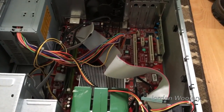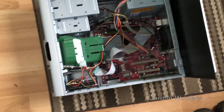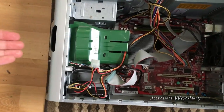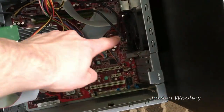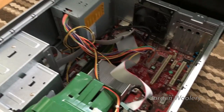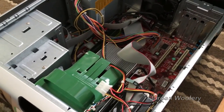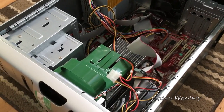The E2600S is effectively a thin but tall business-class desktop which used the exact same motherboard. This is a BTX motherboard, and you can get a good look at the BTX style form factor. What BTX was trying to do at the time was to make a more efficient cooling design — the CPU sits on one end of the motherboard, cold air comes in through the front of the case, is blown past the CPU by a big fan, and is exhausted out the back. Dell used it with their 700 series Optiplex and the GX620. It didn't get too terribly popular but did see some use. Of course we know ATX today, which was introduced in the 1990s — BTX tried to be another form factor but didn't quite catch on, though it did see use with OEM-style systems.